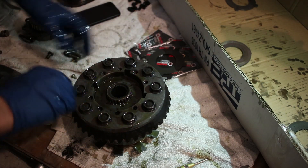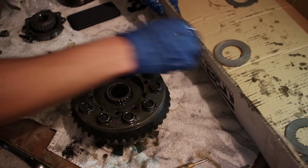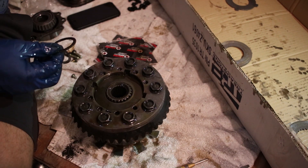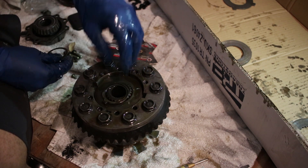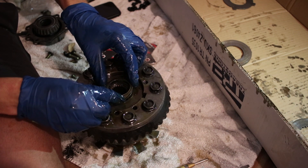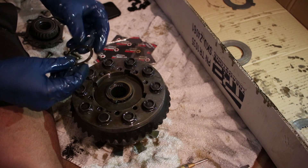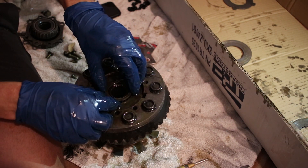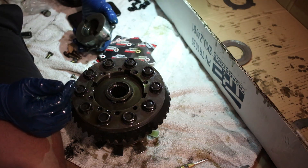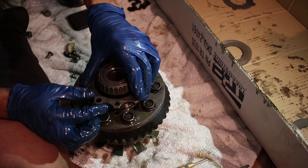The ramp angles are where people talk about two-way and one-and-a-half-way. Now on top of the spider assembly, put a disc first, then plate, then clutch — this is the one you have to be careful with because you can crack those. Dog ear, yes. Now you can do the large Belleville spring with the large radius down. That last small Belleville has the spring radius up towards the carrier and the large towards the spider ears, so large down, conical up. It does need to line up with the recess tab on the case cover.